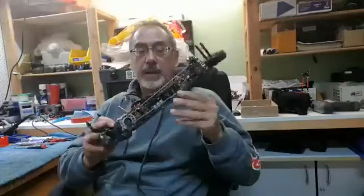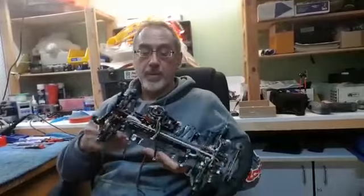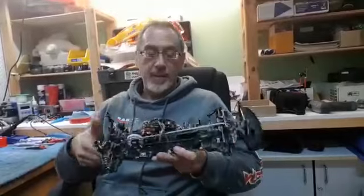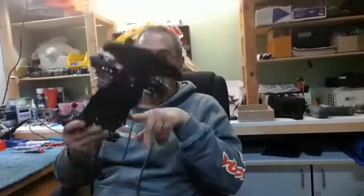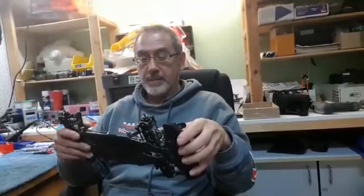If you're running on asphalt that's cold, run a 2.4 with only 4 screws there and 2 up here, none in the middle here, and the car's got really nice flex right through the chassis, which gives it a lot more grip on the rear end, especially when you're trying to put a lot of power down from the motors that are available on the market in the 13.5 category, which I run. The whole car's Team Powers: the servo, the speed controller, the Radon speedy, the motor. It is the stuff that I bring in, so I do run it. I like the car. It's something different. It helps me drive a lot better because there's a lot more options to tune to really make it work. So it's kept me up to scratch of what I've got to learn.